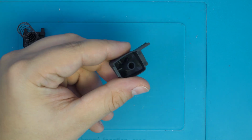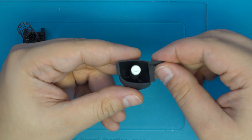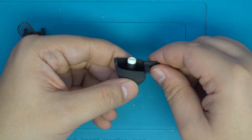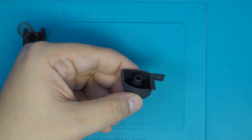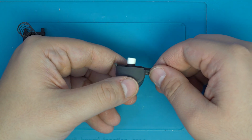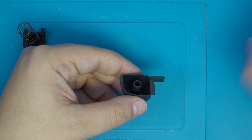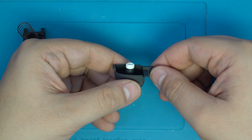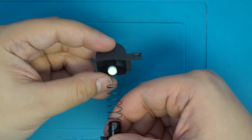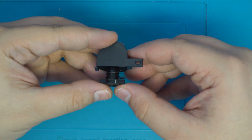Our new button designs also come with trigger plugs. They come with two different sizes, a small size trigger plug and a larger size. We prefer the smaller size trigger plug, so we'll go ahead and insert that into our button before we put our button and membrane set back together. The button and membrane go back together just like it was OEM, minus that metal clip.